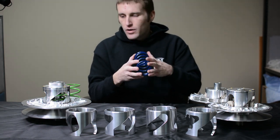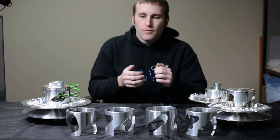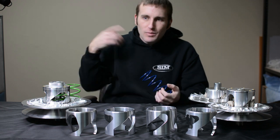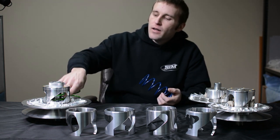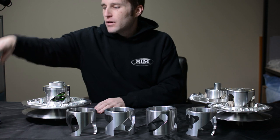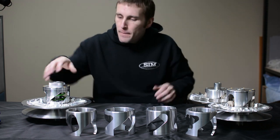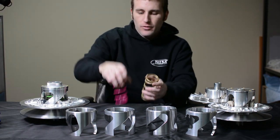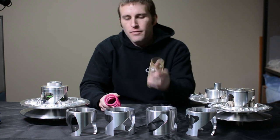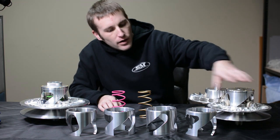If we know the spring rate value, we can determine how the load on the car is going to behave. A stiffer or heavier spring is needed for either larger tires — because we want to hold the car in lower gear longer — or in a sand situation, because the tires spin so easily and we want to control the secondary and not let it over-shift. Spring rate also affects the operating RPM a little, because it affects how fast the secondary clutch is able to shift. The gold and pink springs here are more for Can-Am style clutches; the gold one is a 193-35 and works the same way.